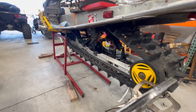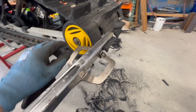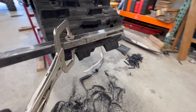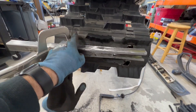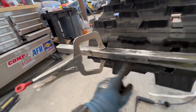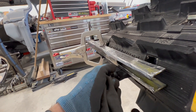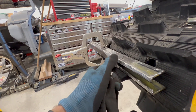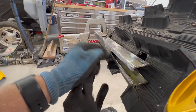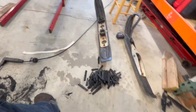This is the best way I found. I put the notch in here, clamp it on, and then cut it off. The bracket I made doesn't fit because of the rod over the middle ones, so I clamp it here and cut it off here. I tried doing this for all of them but was getting really odd cuts. With the bracket they're a better cut. So I cut the middle ones this way and the outside ones with the bracket, and it's going pretty good — almost done.